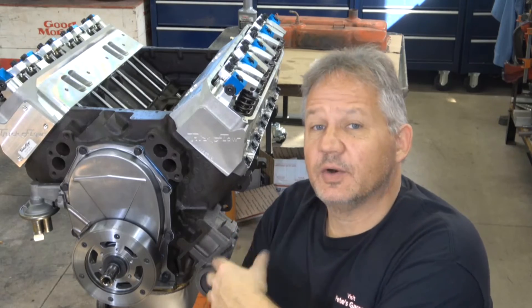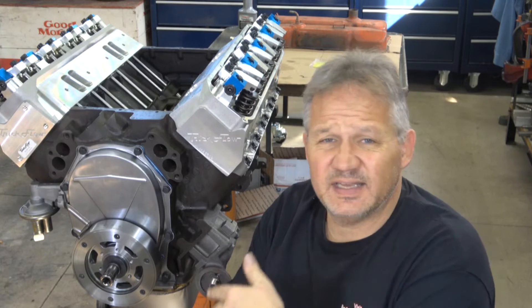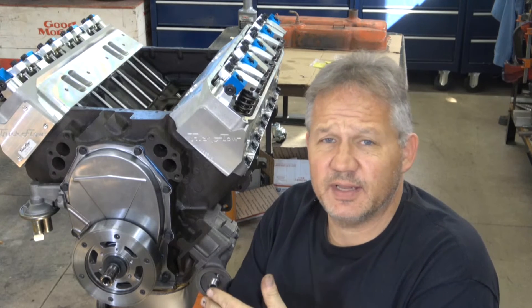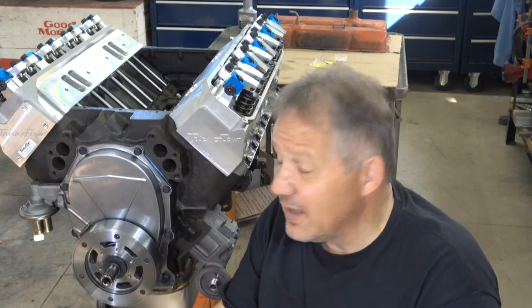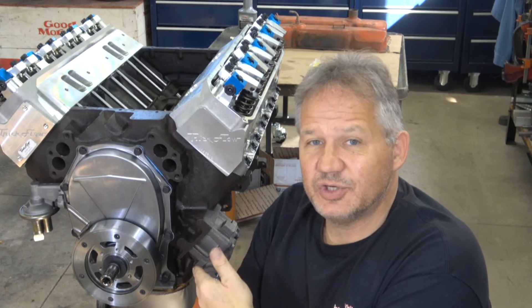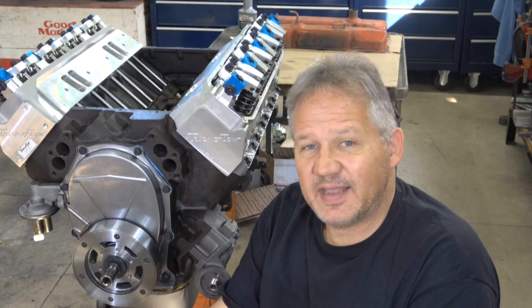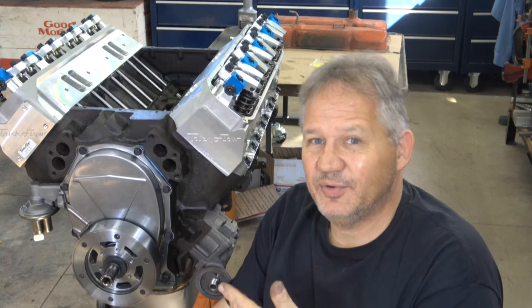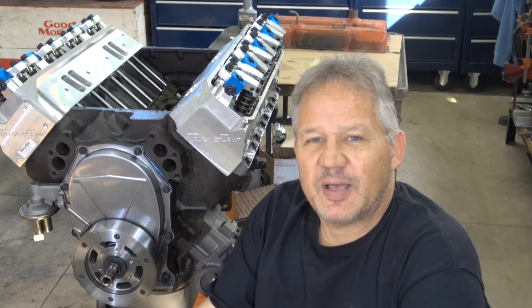A couple routine tasks there — no big deal, but you still need to be careful. You don't want to get any sealants on the inside of the engine; that's what you're really trying to protect against. Seal the gasket around the opening, but don't let it get inside. Now with those in place the block is sealed and I can get ready to prime the engine. We need to talk about priming — flat tappet versus roller, prime or don't prime, what should you do? We'll do that in the next video. Thanks for stopping by Pete's Garage.